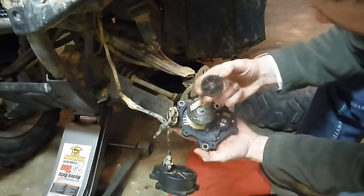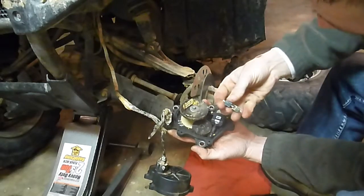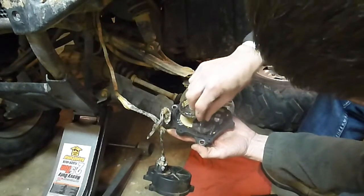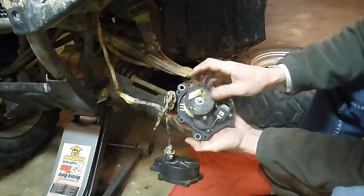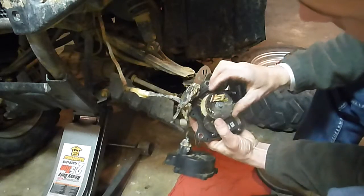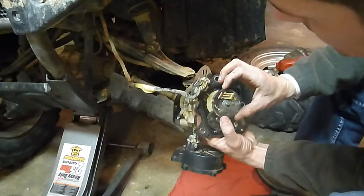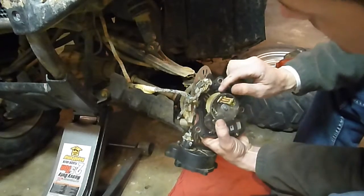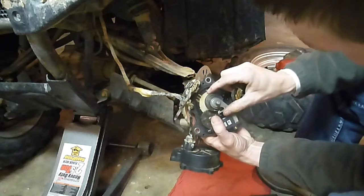You can see it's got a flat side. Put the flat side down, stick this inside of it. There's a hole there that fits inside - it meshes with the worm gear. Before you put the top of the case back on, so you can free spin this, you want to make sure that those two dots are lined up right here.